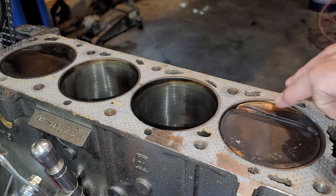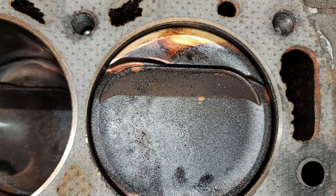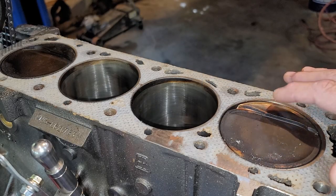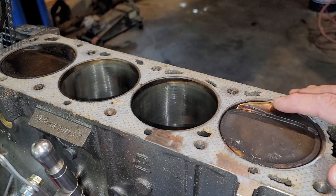As you can see right here, we have this nice little clean spot. This one's the worst of the bunch. This one probably broke a ring, or the wear in this area is from a lot of blow-by on this motor, which is why we pulled the motor out. I'm almost 100% positive the blow-by was coming right through here.